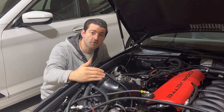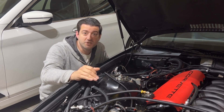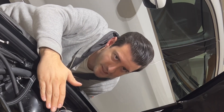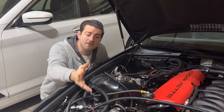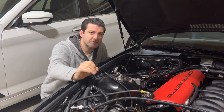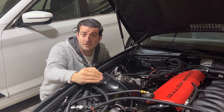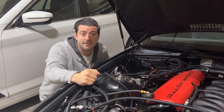I'm going to trigger the fuel pump to turn on at over 50% throttle or 2 PSI. If I'm over 50% throttle, I'm probably pushing it hard, so I'm going to be needing more fuel. It'll kick on then and be able to pump more fuel out of the tank to handle E85. Because when you're putting a car on E85, you need about 33% more fuel than you normally would on 93 for combustion. That's why you need a better fuel pump to run E85.